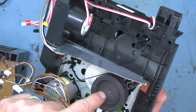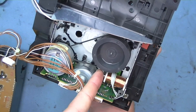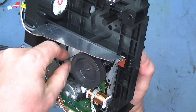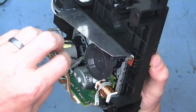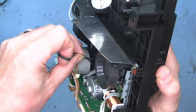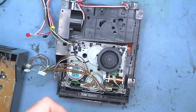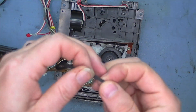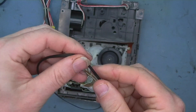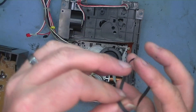Now we can get underneath and see what's going on. I can see straight away that this belt doesn't feel the greatest. I also feel that solenoid might have got stuck - yeah, perhaps it got stuck with age, but it seems to be free now and moving nicely. The belt feels really dry. You should be able to just push the belt down and out - you don't need to take the deck any further. Looking at that belt, it's really dry, not very stretchy at all. It feels more like a strip of plastic than rubber, so it's definitely dried out.